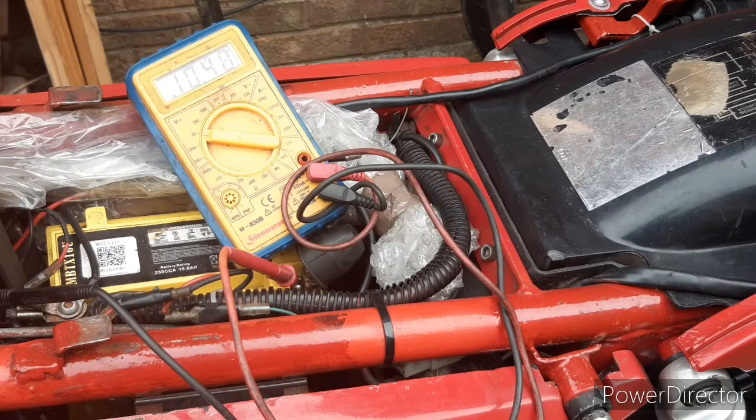Okay, so that's it basically. That is the checks. They're the 3 checks. Just to recap, they were battery base voltage, generator is generating, so we saw the voltage climbing, and the third check was that the regulator is not overcharging the battery, and that showed that the voltage stopped at 14.1 volts in this case. That'll be it.